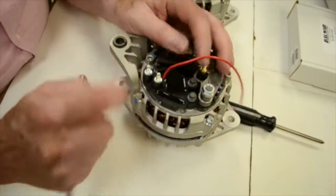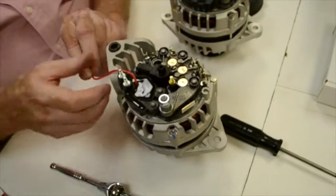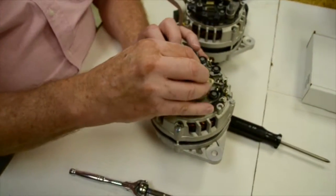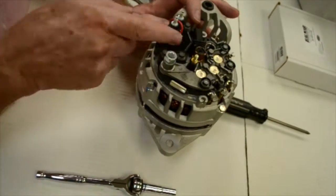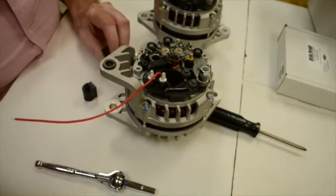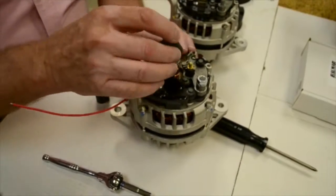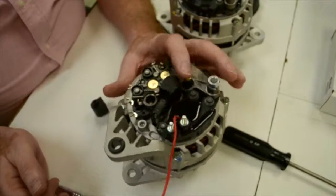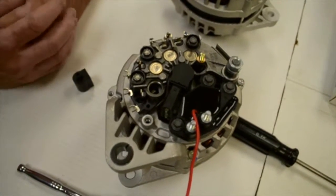You will install our new regulator — put in the three bolts. Once you tighten that down, you remove the brush retainer. As you'll see, that comes off and your brushes are now exposed. In the kit you also have the new brush cover. Simply slide that over — there are slots there that you've got to put that in. Slide that over and basically the initial installation is complete.